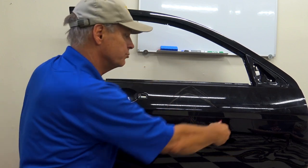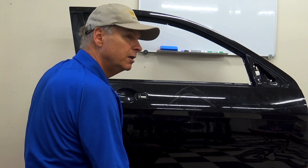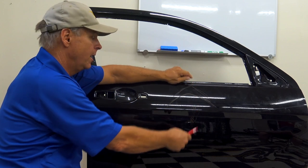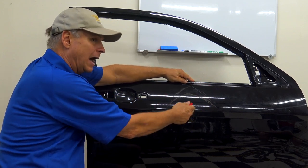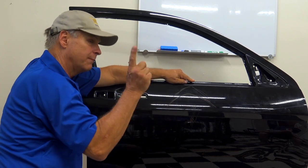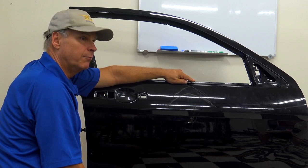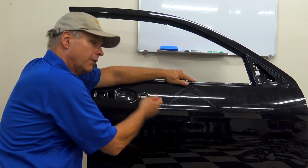Your last damage, guys, was the whole panel going into a little bit of compression. Just a tiny little bit. So when I'm putting pressure on the body line, I don't even help my crown move. Now, if I got the pressure traps out, I'm focused on my body line, and as I'm putting pressure on it, watching my body line hinge move, I am still watching for any horizontal pressure traps that appear. Every once in a while, you missed one. You had a brain fart, you missed one. Pull it out. If I see one when I stop, get it out.